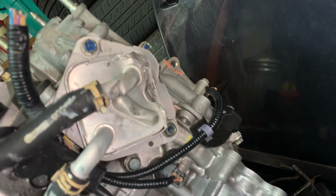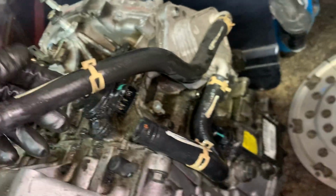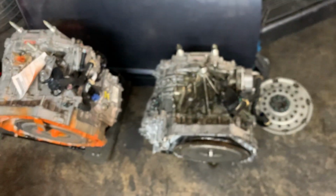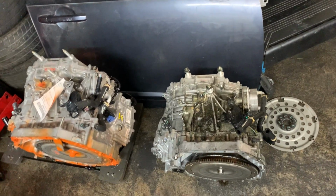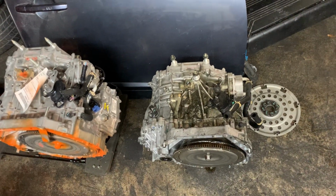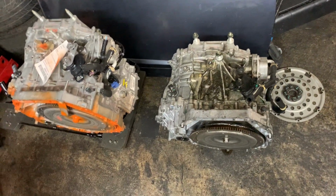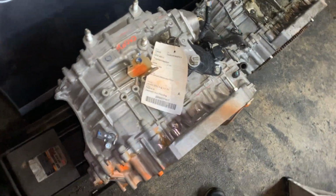off of the cooler. And as you can see, again, part 1 video, I mentioned how the cooler was damaged. And this cooler is not damaged, and neither are the hoses. But when you shake this transmission around, you can hear literally all the broken pieces inside of it. And I'm not taking any chances of that cooler being contaminated with any of that and having the liability of that. So they're buying a new cooler. This transmission, other than that, looks pretty good, looks pretty clean.